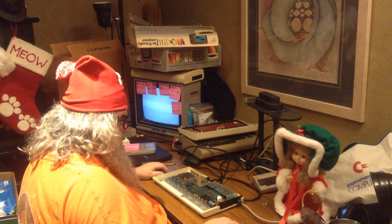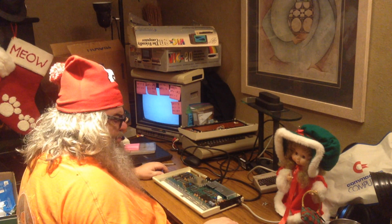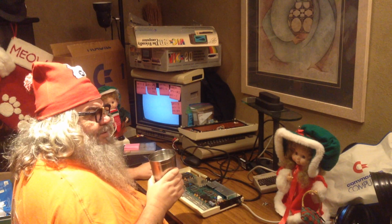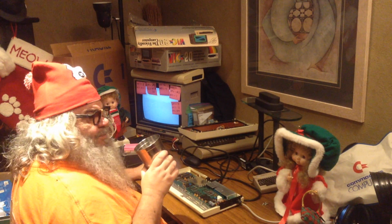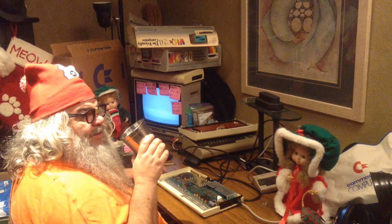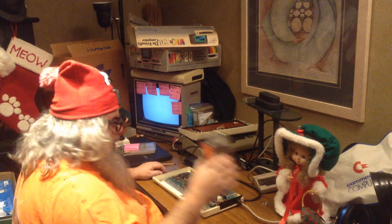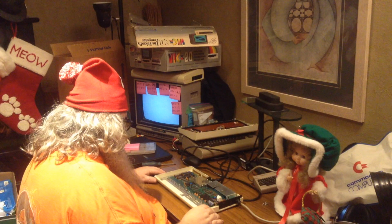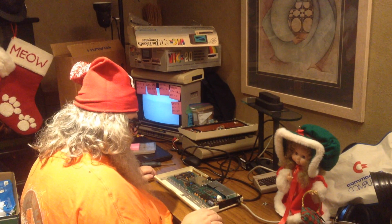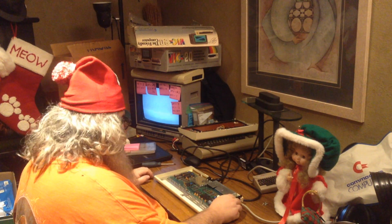The reason I say the screen flash is important is because I've heard there have been people who have noted, I think it was with Vic-20s, or at least some of the Vic-20s, that you could turn it on and have the LED light up, but still have a blown fuse. Because somehow the LED didn't care if there was a fuse. But that would be if you turn it on and you don't see a screen flash of any sort.